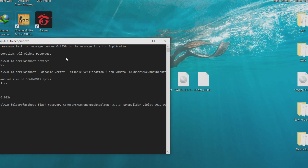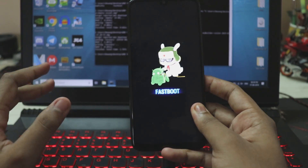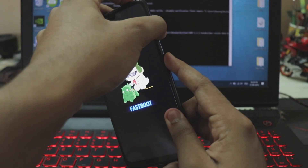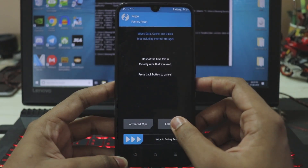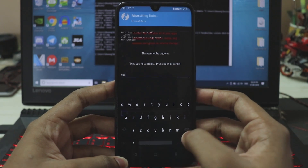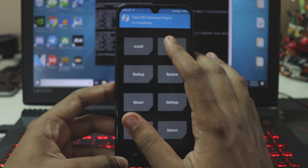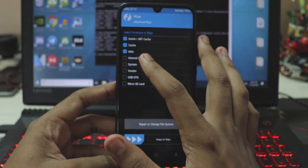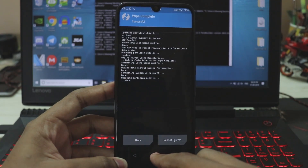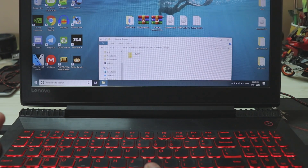The custom recovery has been successfully flashed. Do not reboot your phone — if you do, the recovery will be gone and you'll have to repeat the whole process. Instead, press Power + Volume Up until the Redmi logo shows up. Go to Wipe > Format Data and type 'yes' — this is necessary to remove the MIUI encryption, completely wiping and decrypting your phone. Then go to Wipe > Advanced Wipe and wipe cache, data, and system — but not the vendor partition, as you still need vendor for networking and Wi-Fi firmware.